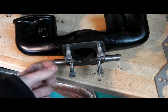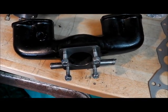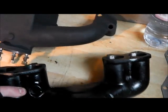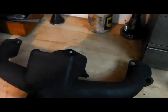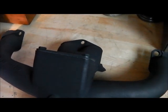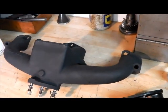We've got a new inlet exhaust manifold to suit it. This has a little water passage through it to stop carburetor icing in winter. Obviously that's for the vacuum pipe for the servo if you've got one. I've got a new exhaust manifold as well. There's a blanking plate for the hot spot, so we'll do away with a lot of the problems that causes with modern fuel.